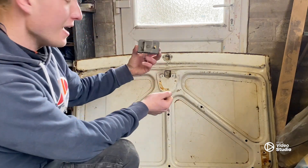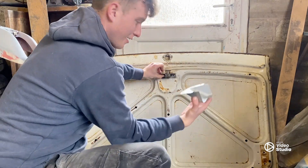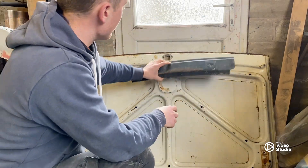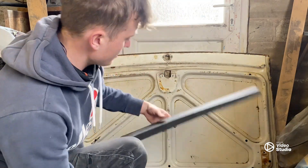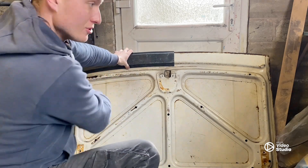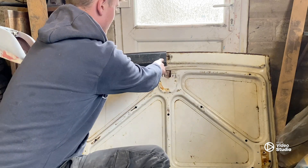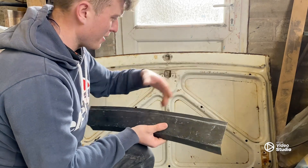What I have found in the car is the lock for the boot — I'm guessing that goes there, something like that. I also found this plate and that goes there like that and holds it in place. Very kindly, the guy I bought this car off gave me two repair panels — one that goes there like so, and another one on that side like so, just lining the corners up. Hopefully this will make it a lot easier to turn this Mark 1 boot lid into a Mark 2 boot lid — I'll cut the lights out and screw them in, a lot easier doing it off the panel like that.